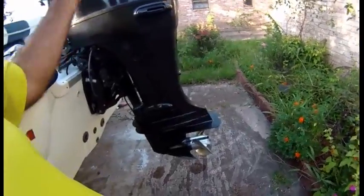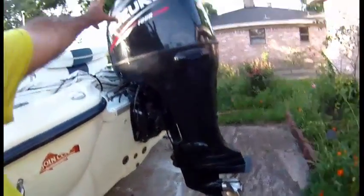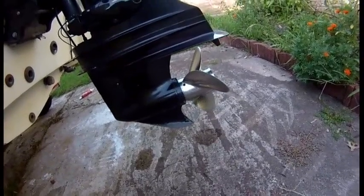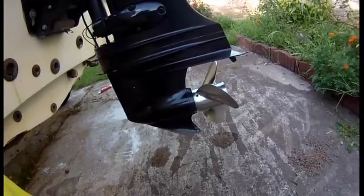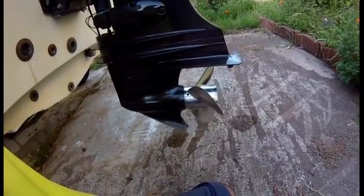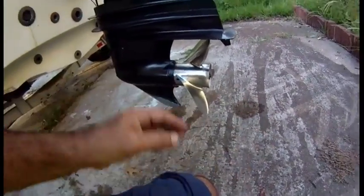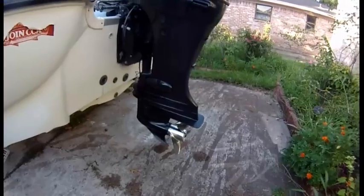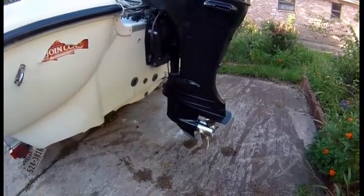The biggest saving is keeping your motor down like this so all the water will drain out. You might see some water come out right now — though I'm having a problem with it moving slow, which I need to go fix, and that'll be another video. Normally if you do that, water will come out. Some of it is from the impeller, some because it's stuck up on top. Good day — I hope that saved you some money. If you like this video, make sure you support it and subscribe.